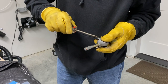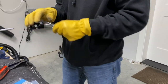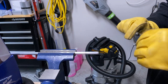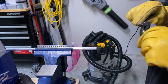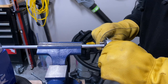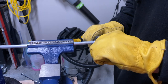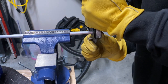Tighten the die in there. And then once you get the thread started, you want to go like a turn and then back off a quarter turn to kind of let the chips come through these holes. I am not an expert in this. In fact, the steel rod was the first thing I ever put threads on, so I'm just going by what directions on the internet said. And I can say for a fact that doing this thing horizontally is a pain as opposed to vertically, but that's what I got geometrically to do here. So let's see, just trying to get it started.